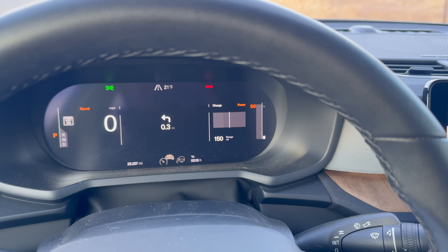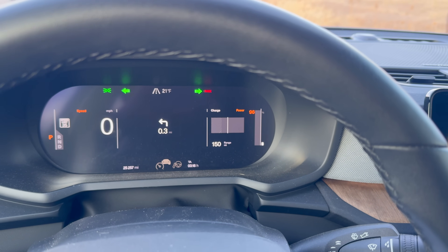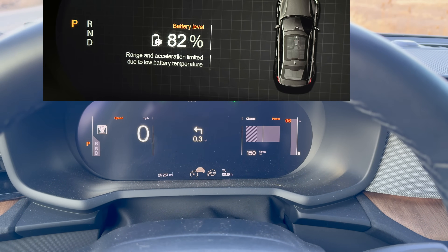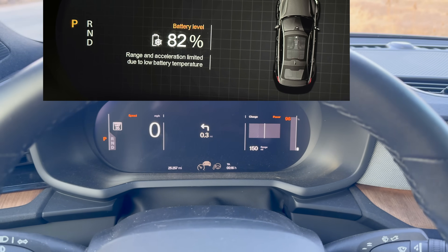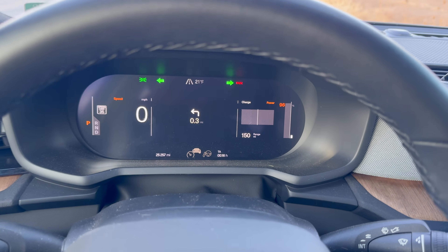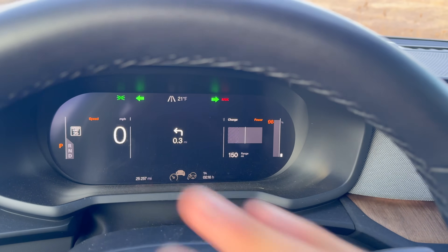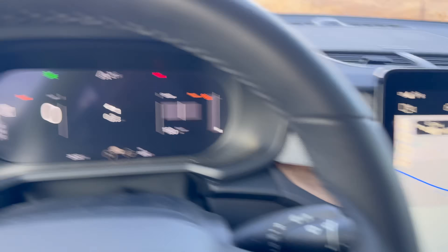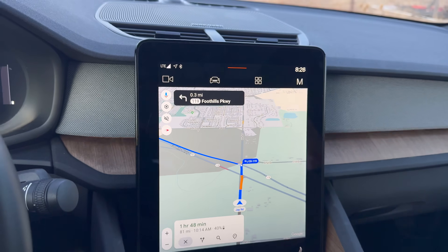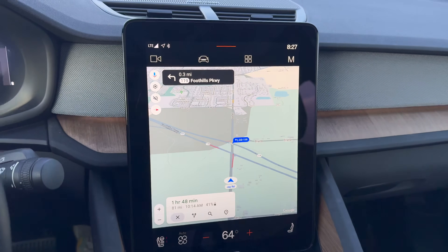However, I think I should be helped out a lot by having a warm battery. There's typically a message in my car that says if the battery is cold, you may have limited performance — acceleration is limited and regenerative braking may be limited. This is because the battery doesn't want to quickly charge or discharge itself when it's really cold. But you can get around that with battery conditioning. I've got a long journey ahead and I'm going to arrive with a little less than half battery along this 80-mile route with lots of elevation and wind.